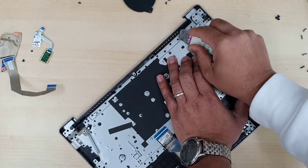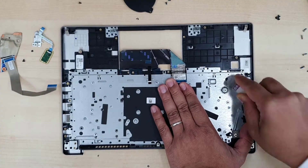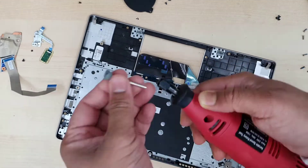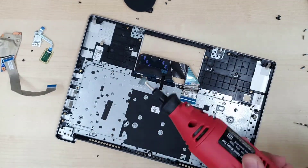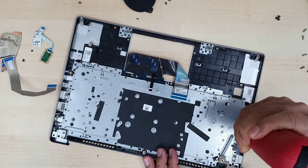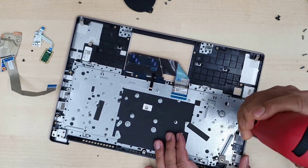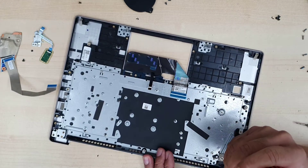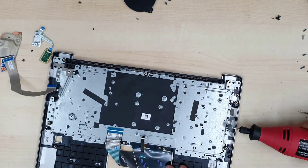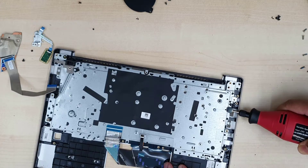As you can see, in the center of this keyboard panel there is a black sticker. Underneath that sticker there are also some rivets, so we have to remove the black sticker and get access to every single rivet and cut them out. Try to clean it as much as possible, otherwise it could make a lot of scratches on the palm rest.